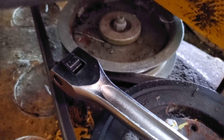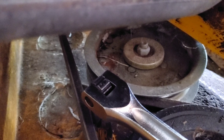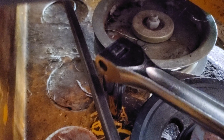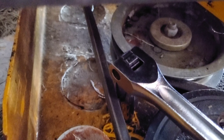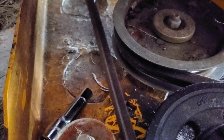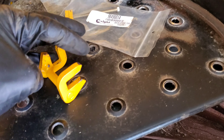I'm going to start the mower up. I'll leave the belt covers off for now — but never do that normally; you're never supposed to operate without the belt covers. I need to be able to see and make sure the clearance is right on the drive belt and that things don't bind.